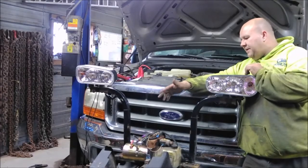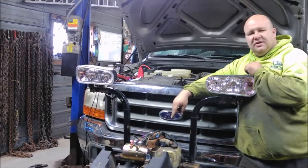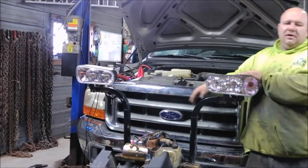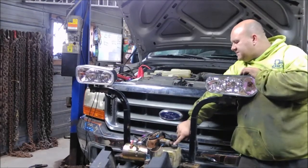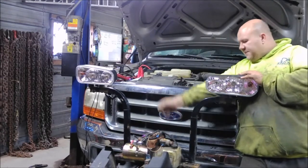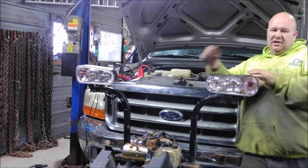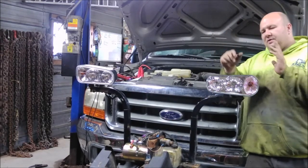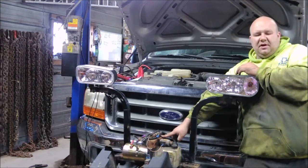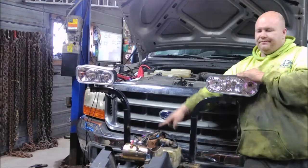You can see the shiny new pump on there. That was as simple as unhooking the red wire and the ground. There was another ground that came off one of the solenoids into the main ground there. These other solenoids ground through the body of the solenoid so you don't have to have a second wire — all they do is take current in, open, close. I've had problems with these in the past as well — your pump will go up and down but your plow won't turn. There's a slider valve in the center that slides back and forth. Sometimes these have a little nub on the end. I've had the slider valve just stick sitting all summer. I've never had success hitting it with a hammer to get it loose, which of course is always step one — hit it with a hammer.